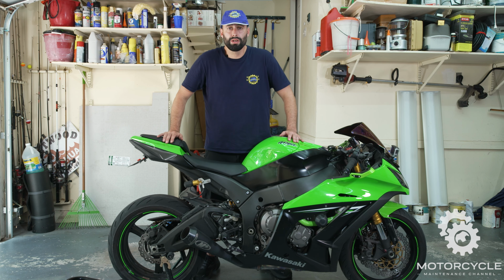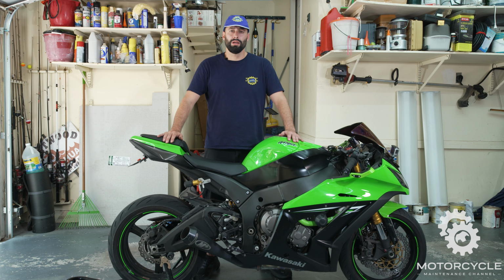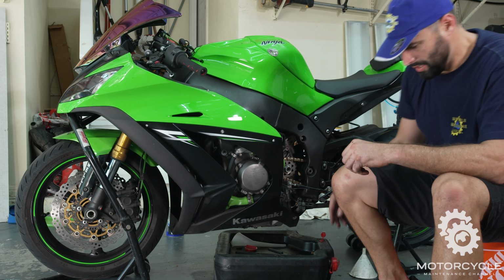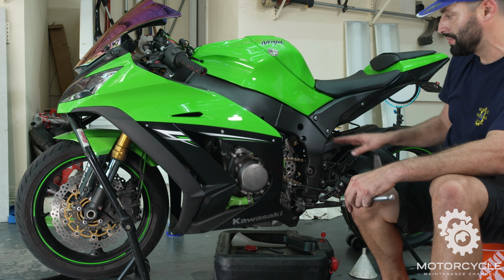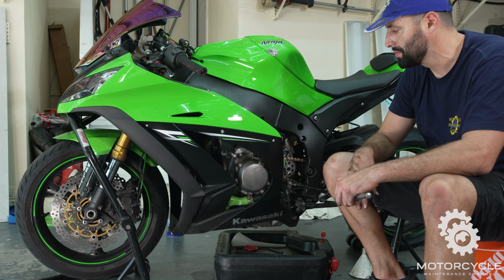On this episode, we're going to show you how to change the oil on this 2014 ZX10r Kawasaki motorcycle. Stay tuned. All right guys, to change the oil, you want to first raise your bike and put it up on bike stands the way we have this one here.